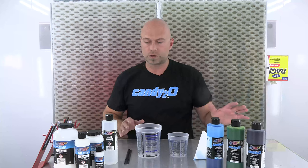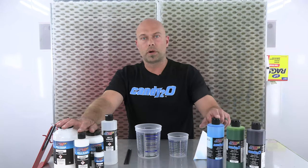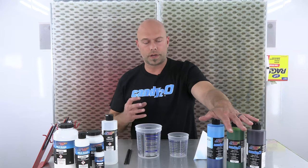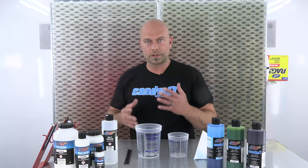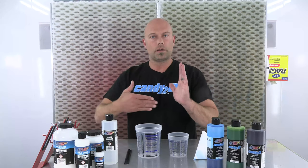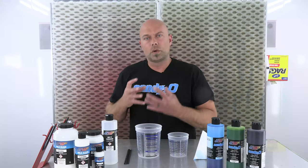These are the two components when spraying candy — applies to spray gun and airbrush. We'll start with spray gun first. Six to one is the ratio: six parts 4050 to one part candy. That extends the concentration, because these are dyes — they're very concentrated, very rich. Six to one is just enough to allow you to slowly and gradually build up color nice and uniform. Candies are a little more difficult to use in terms of exacting your overlap, your pass, your distance off the panel, so six to one makes it a little easier to spray. You'll typically build color over three to five coats for that color saturation.